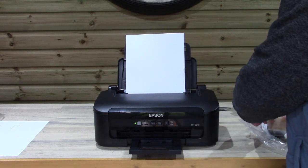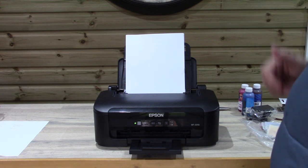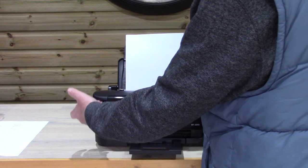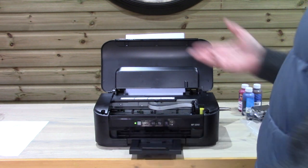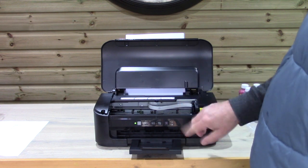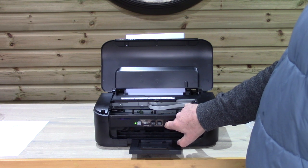I filled three other cartridges earlier — Blue Peter moment — this is what we did earlier. I'm now going to take the current cartridges out and show you how to replace them with the refillable ones. We know the printer is working fine because we've done the nozzle test. To eject the cartridges, hold the button in for up to ten seconds.